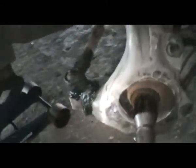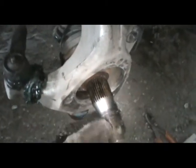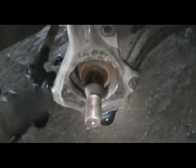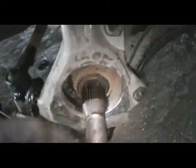We're going to change the tie rod, but first I want to put the hub back. Actually, it'll make our life easier if we change the tie rod now before putting it back. On the other tire I'll show you how to change the tie rod without removing any of this. Also, if you want to change your axle, this is a good time to do it. To pull out the axle, just yank it with your hand — it should come loose from the transmission. There's just a ring down there. You can use a pry bar from the transmission end to pry it out and change it. The way to know if your axle is bad: turn the steering wheel all the way to the maximum right, drive, then turn it to the maximum left, and listen for rumbling or grinding noise — that's the axle.